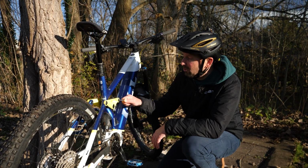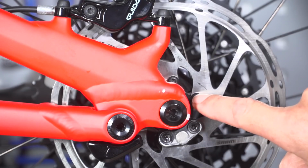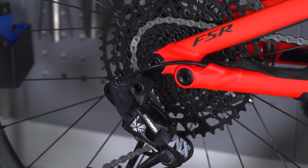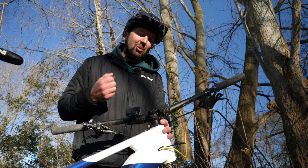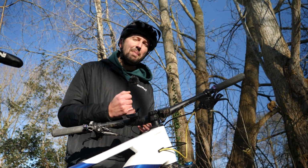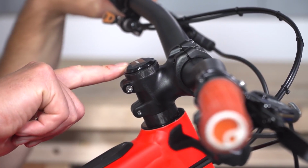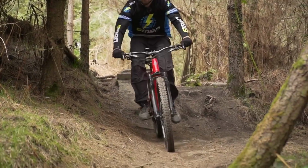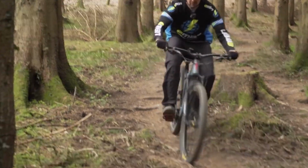Ignoring a basic bolt check on your e-mountain bike is a surefire way of getting caught out, and it's a way of ruining components in one fell swoop that could have been saved with a few seconds just with an Allen key. And once you finish that bolt check, it's a good idea to whip around the bearings on your bike too. For instance, if you're running a loose headset and a carbon frame, you could actually write off that frame set. And it's the same for linkage bearings. If they're running rough, you could flare and again render that frame set completely useless.